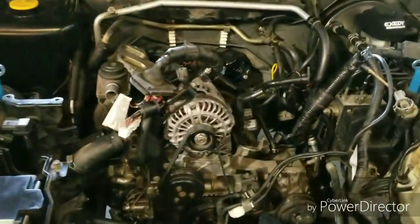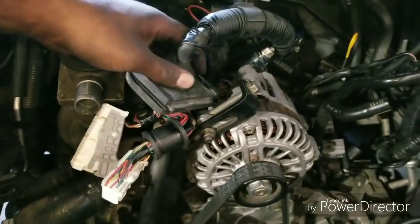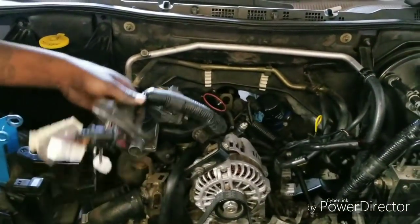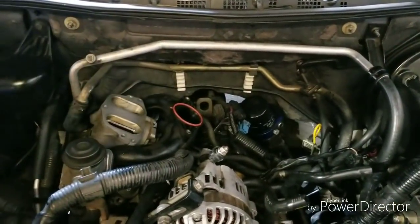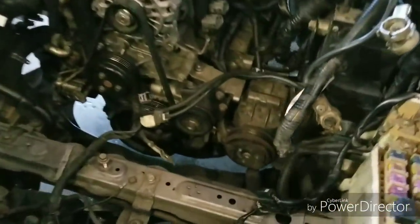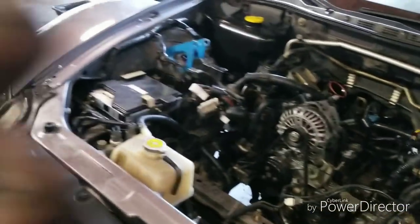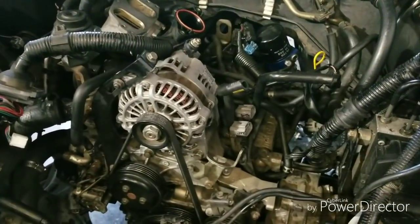So what's your tips, Calvin? When moving motor engines, it's easier to disconnect the harness from the ECU than the harness from the engine. Damn straight. When you're disconnecting your oil lines, you don't have to unbolt them. There's these cool little quick disconnect clips. These guys right here. Don't lose those. Don't lose them. Very important. Makes it easier to disconnect those lines.